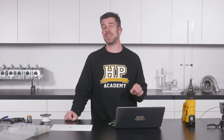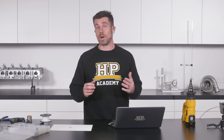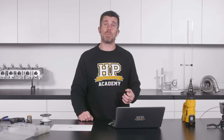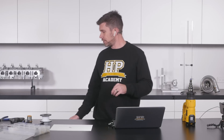Personally I haven't been lucky enough to get that up close and personal with the McLaren F1, so I can only take this as third-hand information — I recommend you probably fact-check that. But the fact remains that for us this is a perfectly good option. The next question with these mounting tabs is how are we going to actually secure them to our engine or the components we want to glue them to. There are a variety of epoxies that would probably do the job. The one I've been recommended quite specifically is a Loctite product — the Loctite 330.